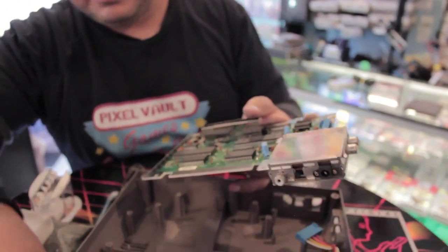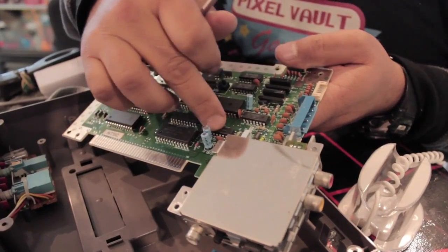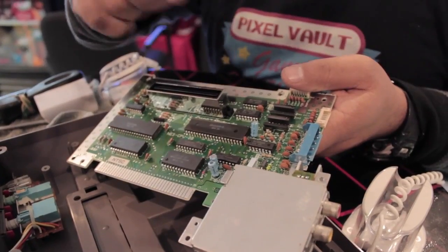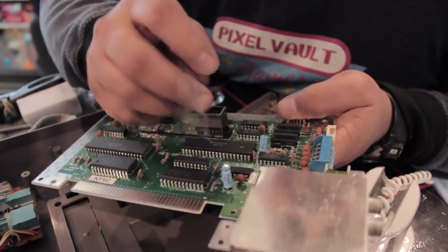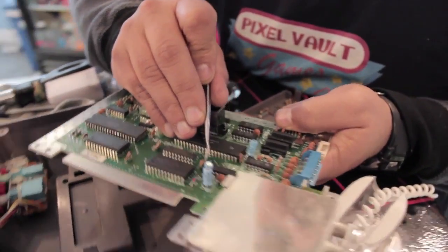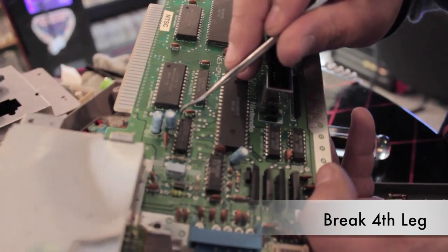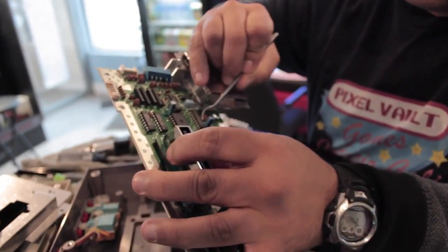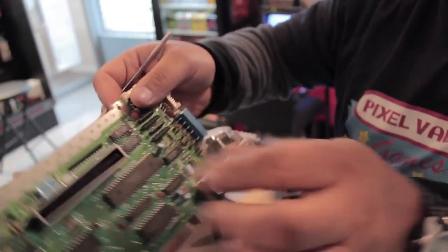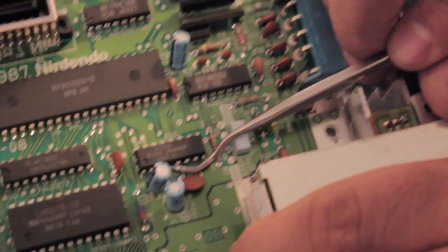This is where this comes in handy. See this part right here — the square — and here's the lockout chip. This right here makes the Nintendo flash on and off when the game is dirty or isn't correctly inserted, so let's disable it. There are four little legs on this. Find that little plus sign or just count one, two, three, four — from the square, that's the first one. Grab your hook and just pull it back. That's all you need to do — just break that leg.